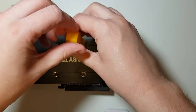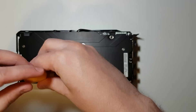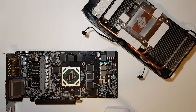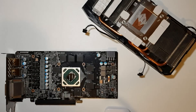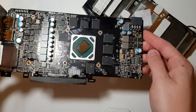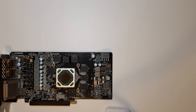Taking the card apart was a simple case of 6 screws — 4 around the GPU and 2 near the rear I/O. After some gentle persuasion the card came apart, and it was immediately apparent why we were experiencing thermal issues: the OEM thermal interface material was absolutely rock solid. Breaking out some isopropyl wipes and cotton swabs, it was cleaned up easily enough. I also gave the card a good dousing in electrical contact cleaner and left it to dry for an hour. The heatsink and fan assembly was also pretty dusty — nothing too bad, but certainly no harm in cleaning it while we wait.